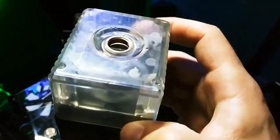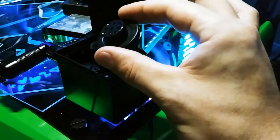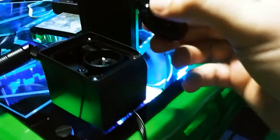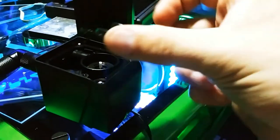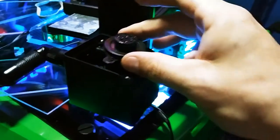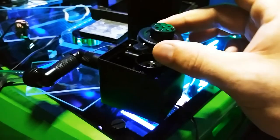I wish this video went way different. I had to tear the system down even more. You see that plastic piece in there — see how it's sitting crooked at an angle? I am pretty sure that is not how it goes. I actually used to have one of these style of pumps and I don't remember it being that way. So I'm going to unzip those four screws, pull this top piece off, and examine that black thing. This is the plastic piece that was sitting off at an angle — there's a little spindle thing inside. That's what I was hearing turning, but nothing was happening because this is like the intake to the pump. It sucks the water in and then spins it through and pumps it out. This thing was all jacked up, so I'm going to re-seat it, put it back together, and see if I can get it to fire on.